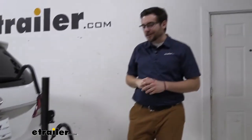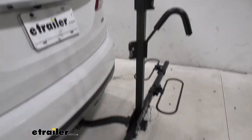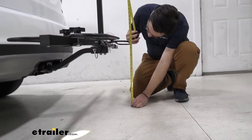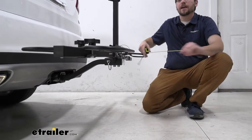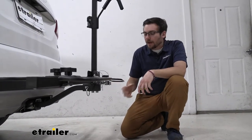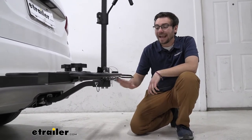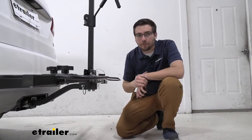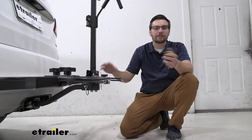If you like those safety cables, they make it a lot easier to track the pin. Now a couple of things we do need to keep in mind — our clearance with this carrier and how much length we're adding to the back of our vehicle. Our biggest dimension to check first is going to be our clearance in this position. From the ground to the very underside of our carrier, that's putting us at 19 and 3/8 inches to the underside. If you have a skinnier wheel width, your bike may hang down a little bit more, so make sure you're getting that measurement as well. If you're approaching any steep inclines, take it nice and slow.